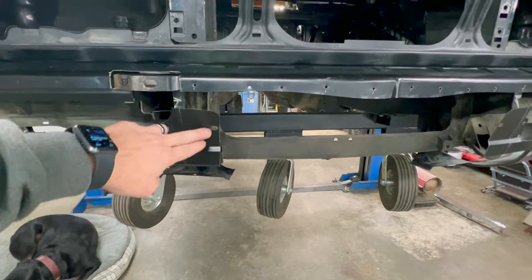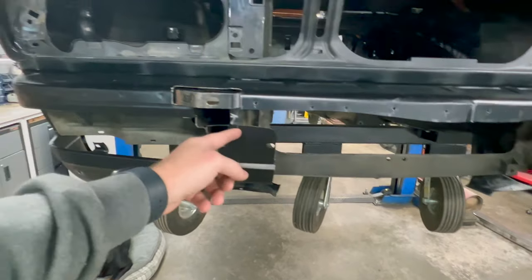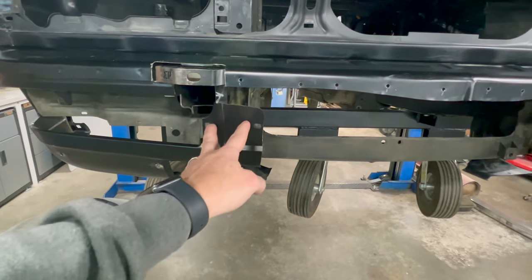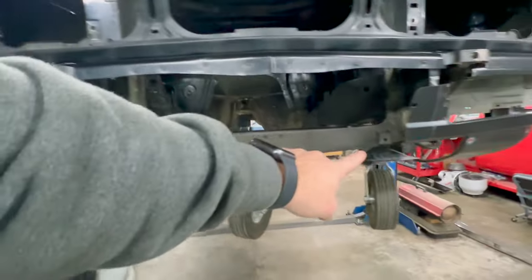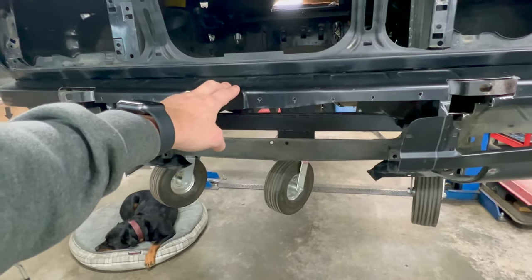That cover plate runs from the edge of the fog light to the oval opening. By retaining that there, I can overlay the new section of the tail panel, and that'll let me line up where I've already cut it and get a good scribe. So I'm very accurate, and I'll just do one side at a time and then tack that piece in place. And then I'll start working on the bottom and getting those trimmed. And then the last thing I'll do is go ahead and tack it up top.